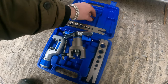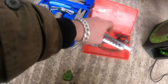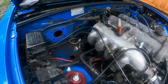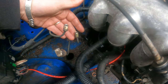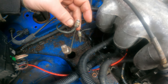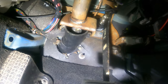I'm not sure the tool is quite right because I think it's a bit more conical and the smallest diameter wasn't small enough. The actual flare thankfully only needs the smallest size here, so they are kind of done — at least good enough. First time we should see whether we've got leaks or not. I had to do them twice because the first time I had the fittings upside down, so the thread would have been at the bottom. But anyway, we can finally put everything back in now.